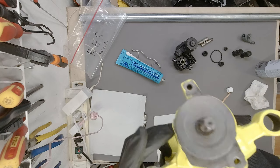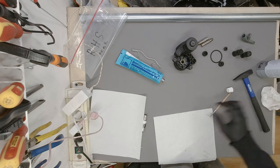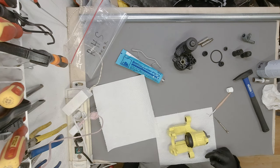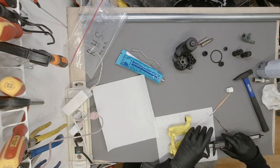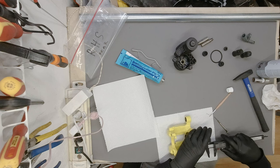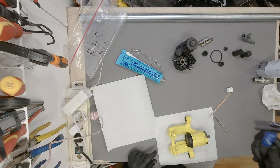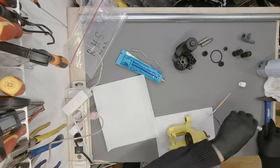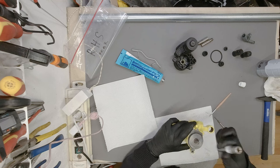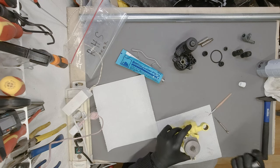You see, we made it. It's where it's supposed to be. We just check one more time if we are at 18.5 millimeters. We are exactly at 18.5 millimeters, which means that this is a great tip. So in my case, a 13 millimeter socket, and gently tap it out, but you need to hold the counter hold on the cylinder itself, or the piston, sorry, the piston.